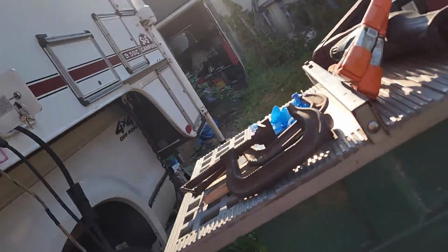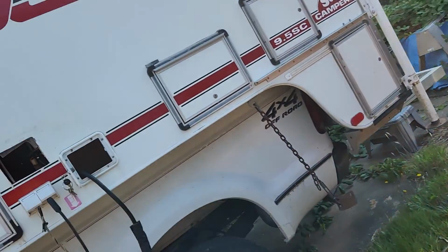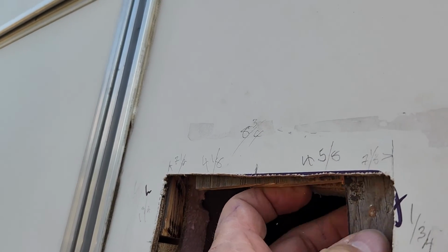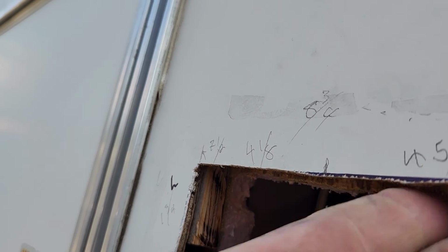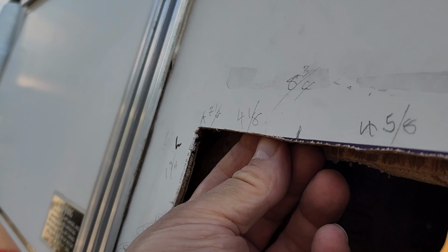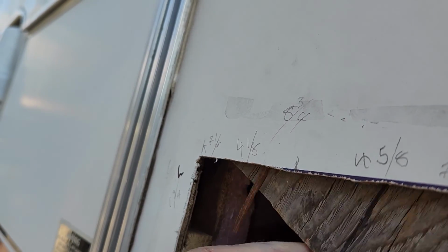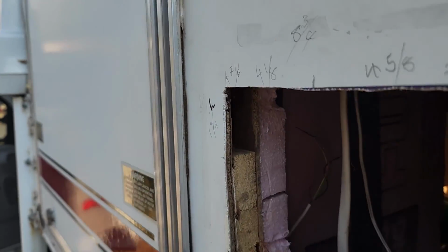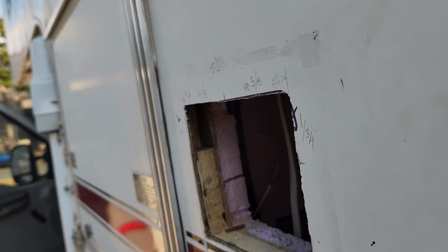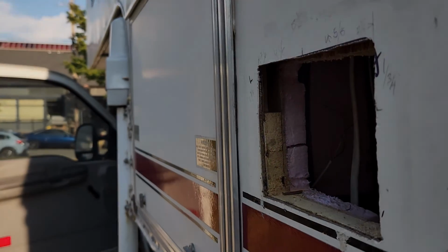So anyway, what I'm going to do is put on some rubber gloves, and then I am going to slather up all these parts in here and stick them up there. Then I will take a couple of C-clamps and another couple of pieces of plywood, and I will clamp there to hold it nice, tight, flat, and make sure that we get a good seal on it.